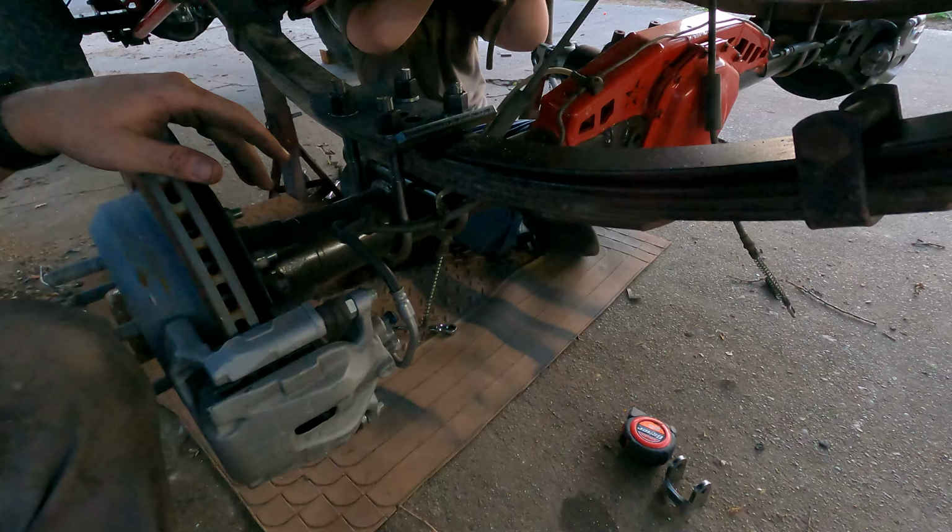When you are tightening the leaf springs, you never want to tighten anything when it's all drooped out. You want to tighten it when it's all on the ground. In this case, what I did is I jacked it up until it got off the jack stands, so I can tighten all these bolts up, and then it'll be good to go, because it's going to droop out, and then it's going to make a lot of squeaking noise.